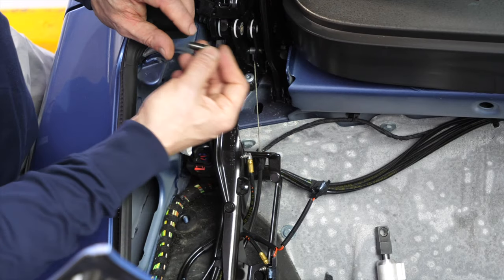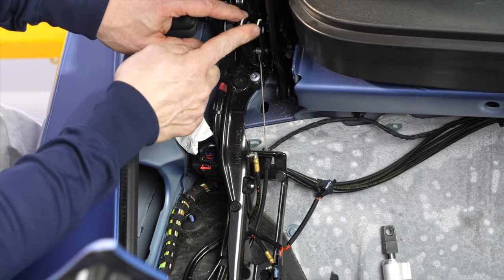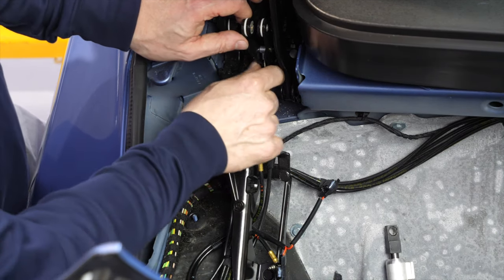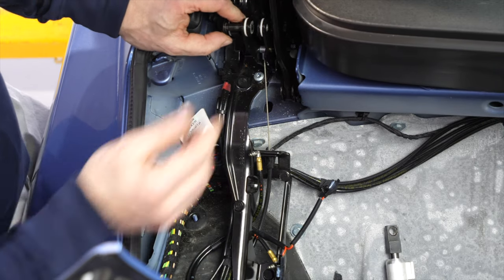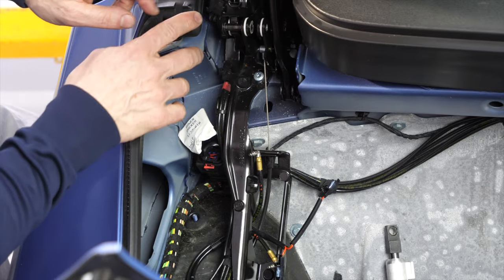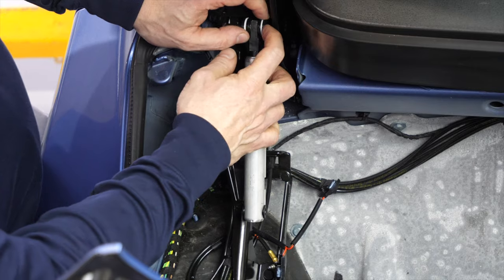When the pin was pulled out towards the inside with the top partially extended, ultimately, once the top was moved back, these inner and outer forks on the top pin got misaligned a little bit. The outer fork is actually only there to pull the cable for the flaps on the end of the tonneau cover, meaning the hinge covers. And I would recommend that you line these guys up again after you've taken the tension out of this tonneau cover. Line these guys up and put the pin in part way from the outside. That way you can already get the cylinder back in here and later put your clip on.